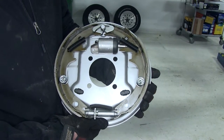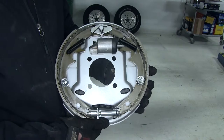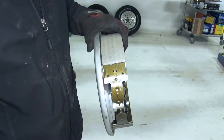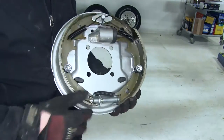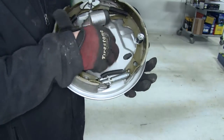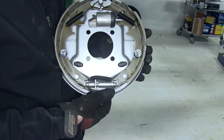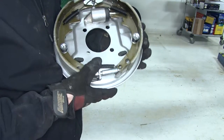This is our brake assembly, going to be installed on the right hand side or passenger side. The pad here is 2¼ inches, designed to fit a 10 inch drum which is typically found on 3500 pound axles. It's got a protective finish on the backing plate itself. It's a simple single servo brake — doesn't have any auto adjustment, manual adjust only — but pretty easy to install.